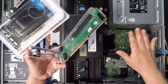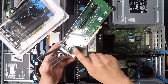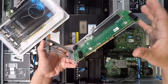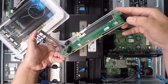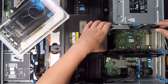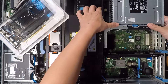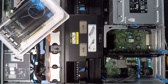When reinstalling the riser 2 frame back onto the server, Dell has provided two guide pins on the board that go into holes on the frame. As long as you align those correctly, installation should go fine. Make sure the two pins are in the holes, the PCIe slot is in the slot, and press down until you hear the click. And there we have it.